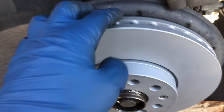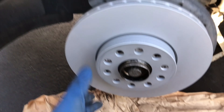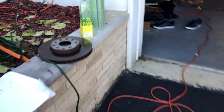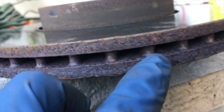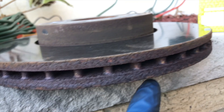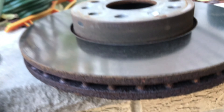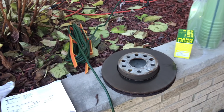The rust coating means it won't crack or rust over time inside the vanes. If you saw the other rotor, it was completely covered in rust inside — it had rusted through and it was only a matter of time. Performance-wise, a nice clean disc with clean pads will bed in and perform significantly better for longer. You can see how it's deteriorating — pieces are already flaking off, so there's a risk of stress fracture from the degraded metal. Rotor thickness is one metric to check before changing rotors, but also consider whether the original rotors lack this type of weatherproofing inside the airflow chamber.